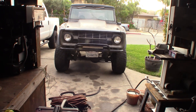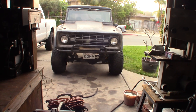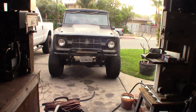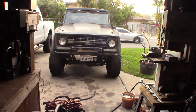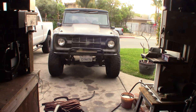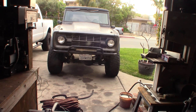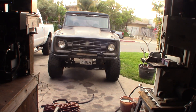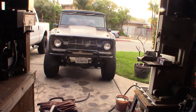AM is really loud typically in this car so it's not a problem there — it's mainly sideband. I can actually hear when I'm driving around now. I still have a lot of work to do. I'm going to wrap all my fuel injection wires in Faraday tape and start wrapping up the whole fuel injection system. It's been quite a headache. I never knew I had a radio problem until I got into single sideband in the car.